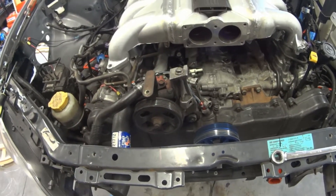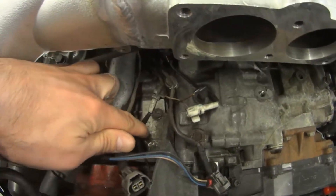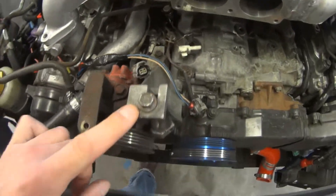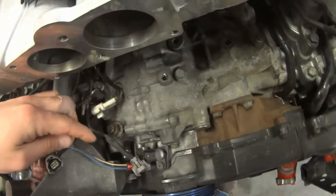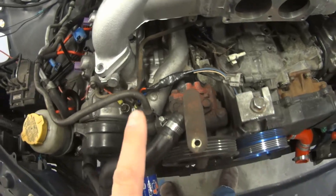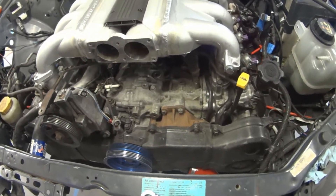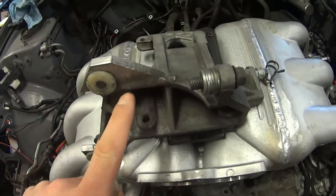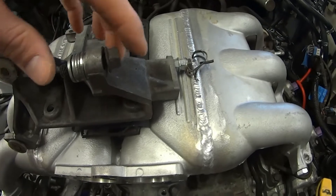If you're curious how I have an EJ power steering unit bolted on here, I'll show you. Basically, this little tab here was welded on and extended out the power steering bracket — this bracket holds the power steering unit and also holds the EJ alternator in place. I put spacers on the bolts here and underneath. The alternator bracket is the same thing — a tab that was welded on, then spacers or washers for where you bolt on — and that worked out really well.